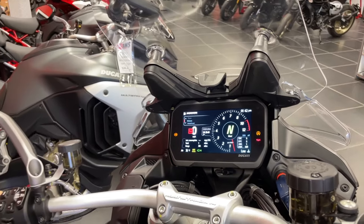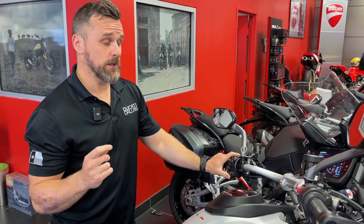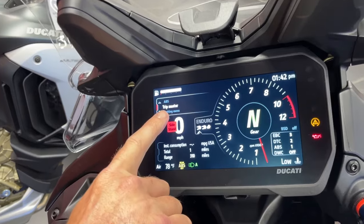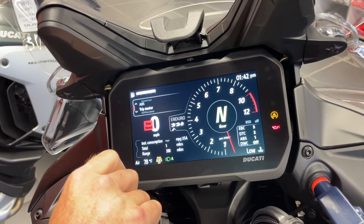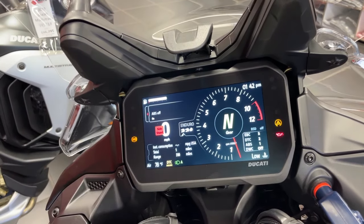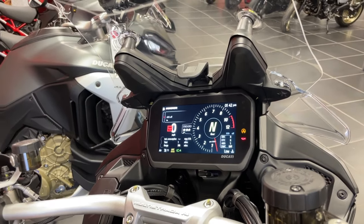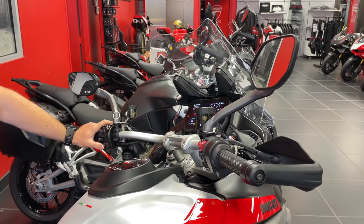In enduro mode it's a slightly different setup. You're going to be able to turn ABS totally off — that's going to be in what I call the north menu on the dash. In enduro mode, not only do you get a trip master which you can set its accuracy to either tenths or one hundredths, but you can also turn ABS off entirely. In enduro, it's going to immediately turn ABS off to the rear wheel, but you can actually turn it off entirely. I think they did a good job with the enduro discipline and giving you some extra quick functionality to tackle those off-road trails or fire roads.